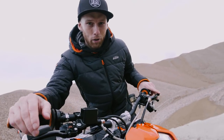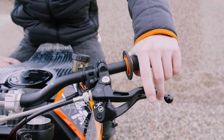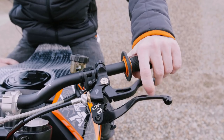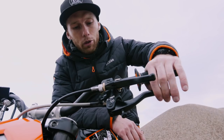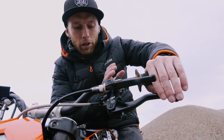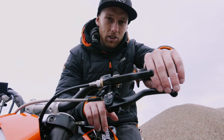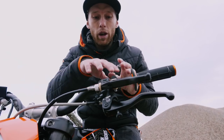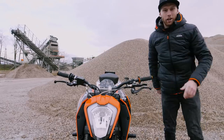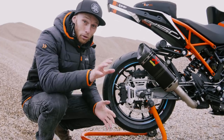On my left hand, which is more interesting — for my clutch I'm using the new Rock Bagger CNC machined clutch lever, which is so soft you can pull it with just one finger. For my stunt brake I'm using the Magura HC1 clutch master cylinder 13 millimeter. Why the clutch master cylinder? Because the connecting bolt for the brake line is inside, so it's much easier to use and it's not in the way of all the components when you put them on the handlebar.